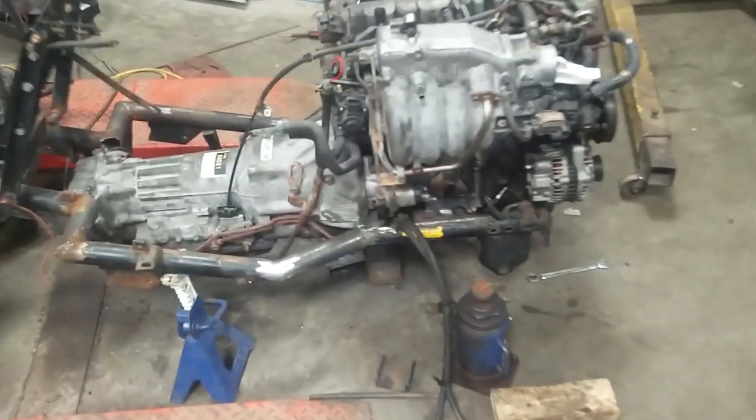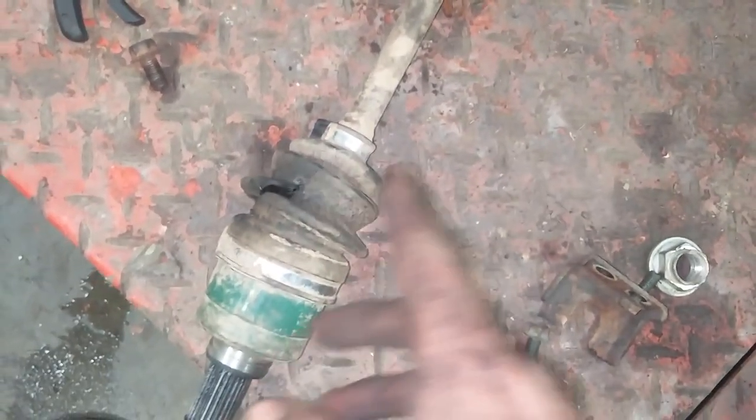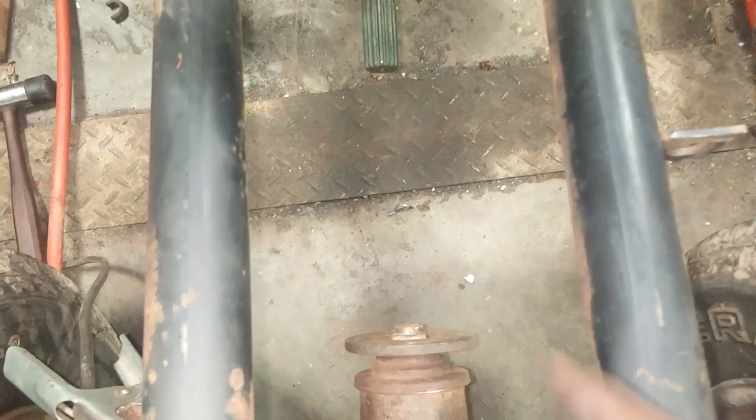I only lengthened the frame eight inches, but it sticks out like four inches total. I really wanted the hood to fit with the radiator, which it would have if I didn't have to have a drive shaft — and that's as short as I can make a U-joint drive shaft. If I was able to use a CV shaft, that would be perfect — I could have it come in straight with a flange right here and then have this go into the transmission; the whole operation wouldn't be that long. But this is gonna work as long as she don't break, and I think I got it pretty true. Hopefully it doesn't vibrate too bad — these are lined up most of the way, the diff's over a little bit but I can adjust it however it has to be.